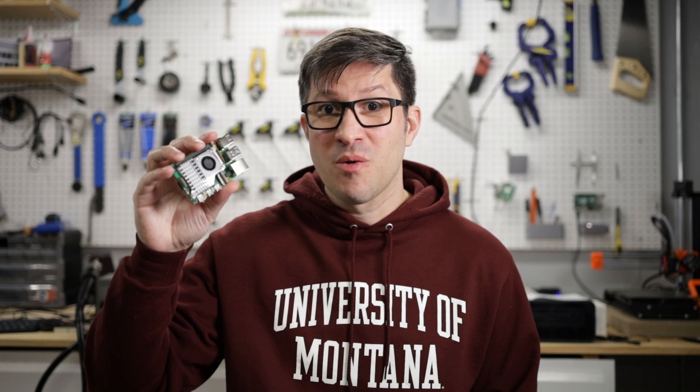So which one is the winner? I don't think there is one winner. If you're looking for something compact for a maker project, the micro SD card makes a lot of sense — it's super compact and just works. If you're using your Pi to stream media like a Plex server, then the NVMe or SSD would make more sense given their speed. One thing to keep in mind though is that NVMe enclosures don't have mounting holes, so how do you secure them — rubber bands, zip ties? On the other hand, SSDs come in a standard size with built-in screw holes to mount to a case. Let me know in the comments which one you're planning on using with your Pi 5.